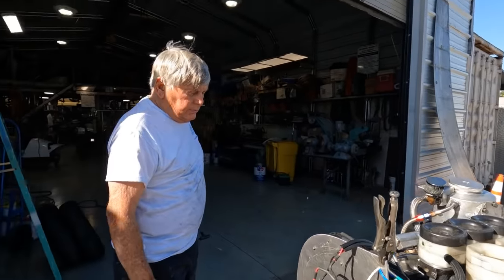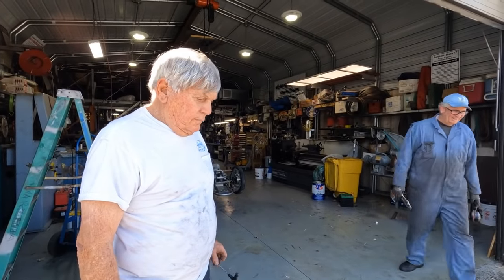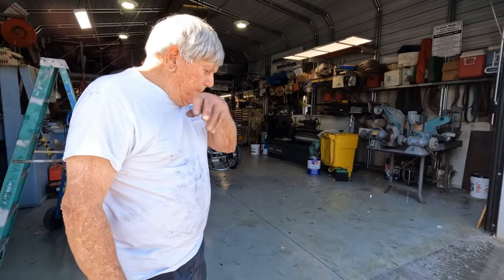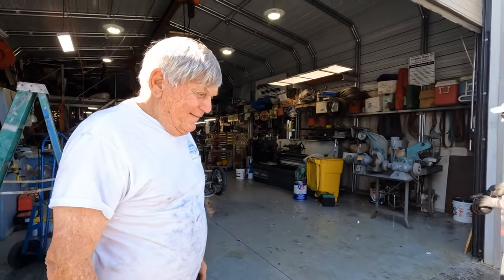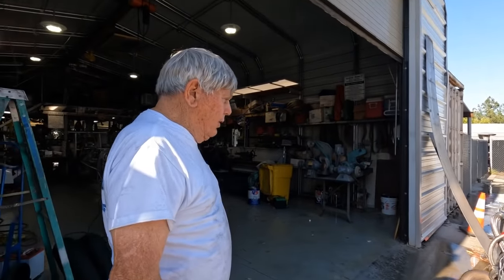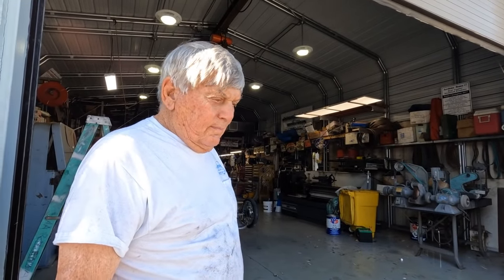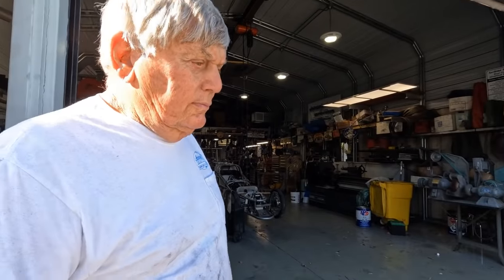I mean, to run this in November out of El Mirage. And then we'd like to run it at Bonneville next year, if nothing goes wrong between now and then. We had it in August, but we gave it up, right? The broken piston. Yeah. So the new pistons are improved a little bit, a little more thickness on the head of the piston. Just a little bit, but that wasn't the problem. It was our fault. Just a lean condition.